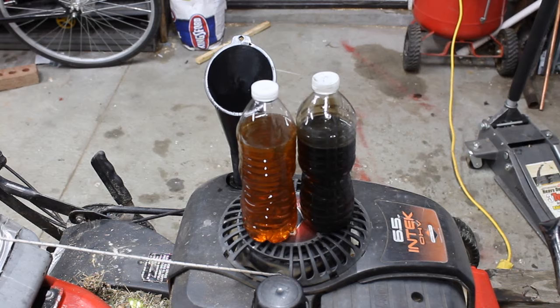In a lot of lawn mowers and equipment you'll go by what your manual says. But in the summer time it is safe to run 30 weight lawn mower oil. Or you can use just regular motor oil — 10w30 or 5w30. Now since this engine does want straight 30, I would advise against getting a 5w20 or 10w20 weight oil. That's just me, but you could go at it at your own risk.